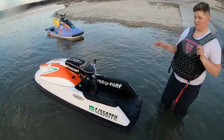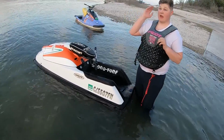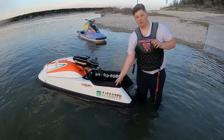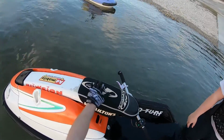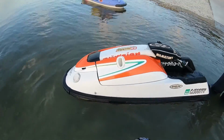They said the perfect way to read the spark plugs is to start it immediately, go rip it back and forth, and then see what the spark plug color is. It should be really light brown. Shouldn't be black. I think it was a good purchase. $3,000.